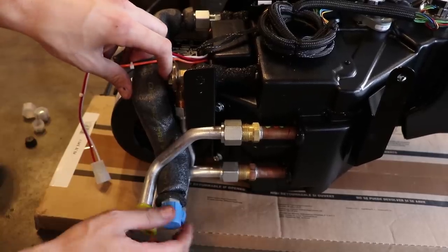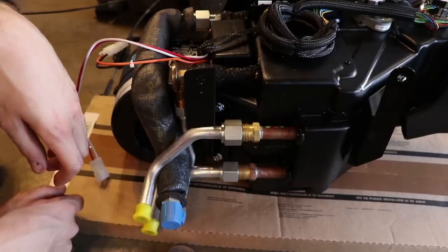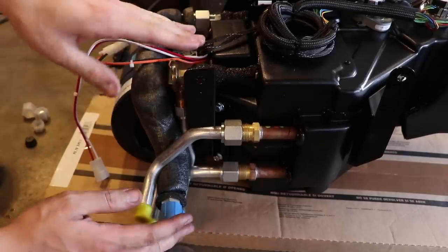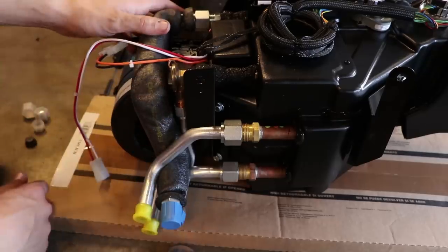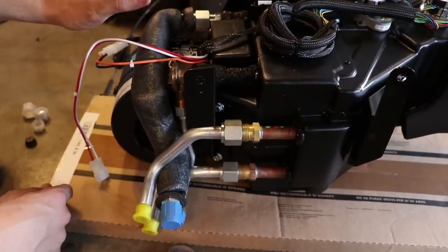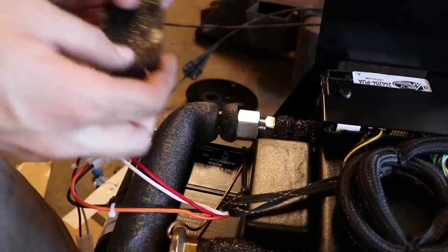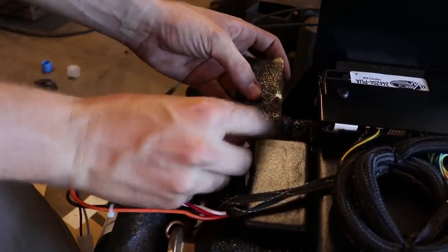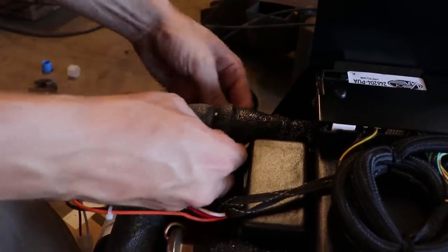They're all right up on top of each other, and when it's tightened up and squared away, it should look just about like that. We actually have a plug for the old blower motor that these are supposed to go through, so we may leave these loose until it passes through to make sure everything lines up properly. All in all, it's not that hard to do. We have all our O-rings in place and the box itself is ready to install. The last thing is to use the supplied press tape and cover up the AC fittings where you've tightened everything up.